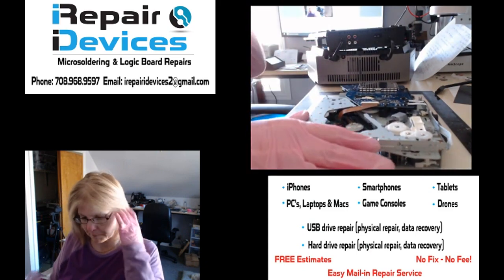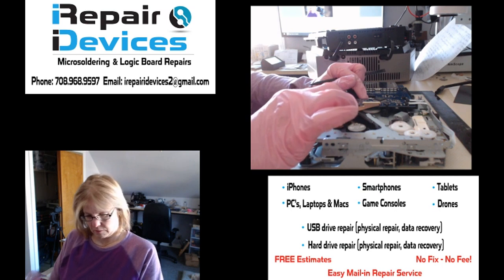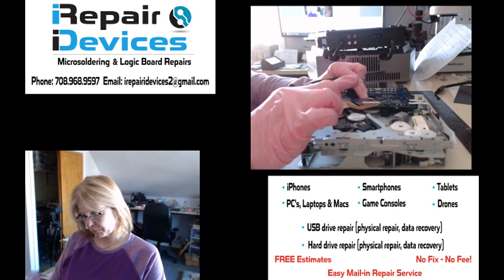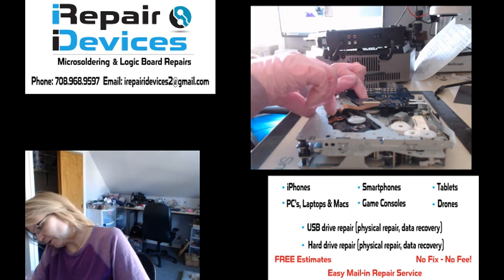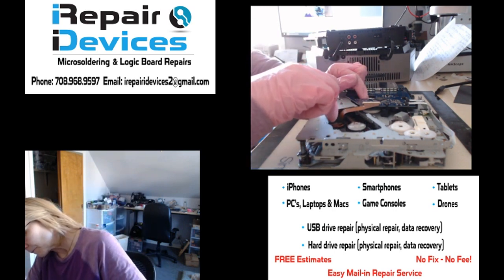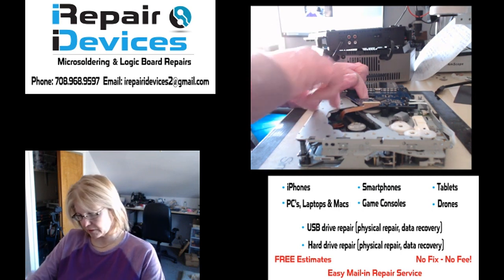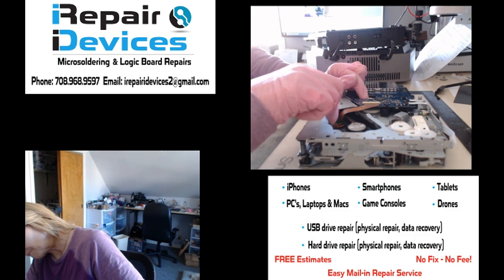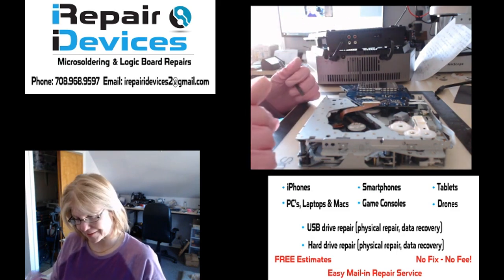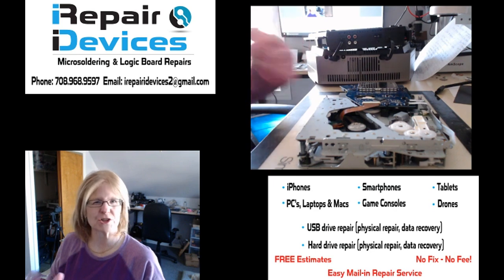So I'm going to flip it back over and now raise and lower this to see if that resolved the issue. I'm going to bring it down to the bottom position first, then work my way to the top keeping an eye on all three worm gears. Back it up a bit. This is when they're hitting the top — the left and center now look good. The far right — they're all hitting the top, all at once. But I really won't know until I test it out in the unit by putting a CD in there, and also whether this resolved the chattering in slot three.